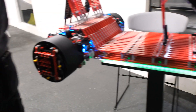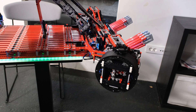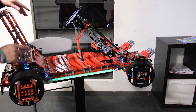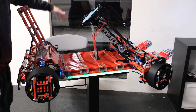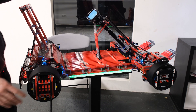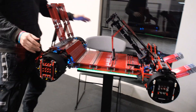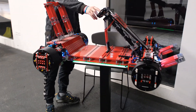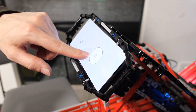Another very important thing is that when you steer, you want to reduce the power on the inner wheels so you can drive around the bend. We are using an electronic differential — when you turn in either direction, the outer wheels spin while the inner wheels have reduced power. This is how the go-kart can do turns without overloading the inner motors.